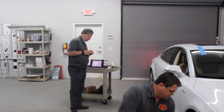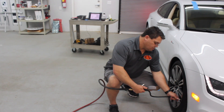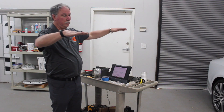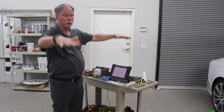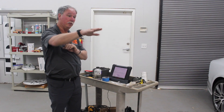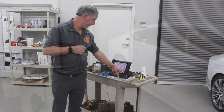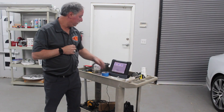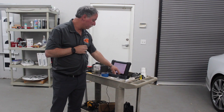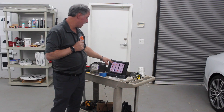This should have 31 pounds in the front tires and 38 in the back. We did wheel alignment checks so that we can determine how level the car is, so that when the computer communicates with the system, the camera knows where the calibration board is. We will now go into our post-scan to determine that all the values have been corrected.